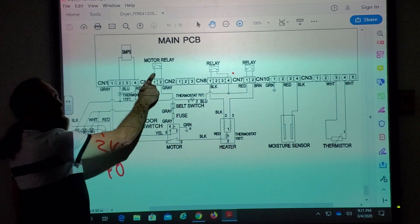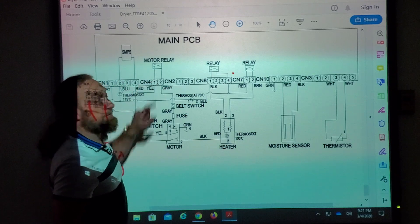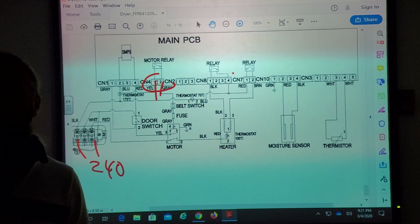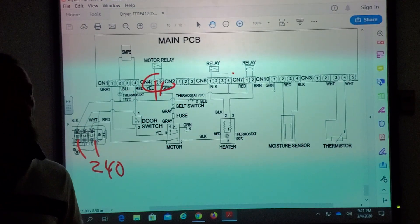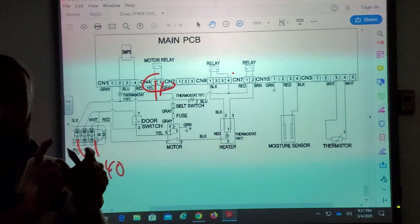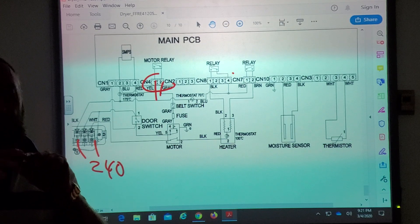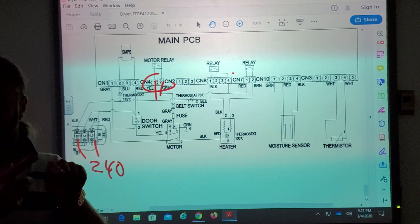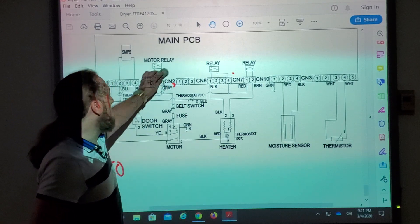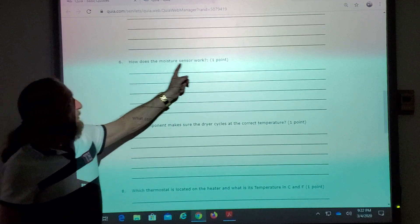The motor is running off the motor relay over here, so the motor will run. Even if the motor wasn't running, the board would still come on. We can even check the motor relay — unplug this plug, put our meter in here, and check continuity of that switch. Remember the microwave? The power relay that sends power to the transformer — that big black relay on the board — we pulled the wires off and tested those two pins for resistance. The relay would still close and you can check if it's opening and closing, as long as the wires are off.